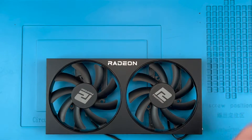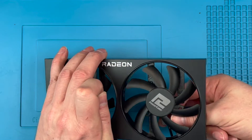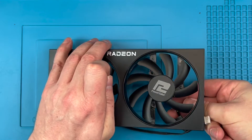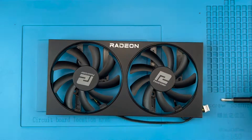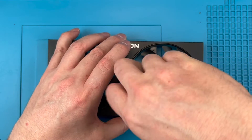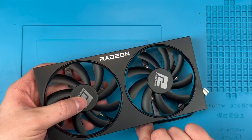Here are my tips on buying fans. Tip 1: check not just the model number, but also the dimensions when buying — the diameter of the fans, the dimensions of the screw holes, and the fan depth are important and could be wrong on aftermarket units. Tip 2: check the cable lengths. I have seen aftermarket fans for various cards where the cables were different lengths, making it either hard or impossible to install them.